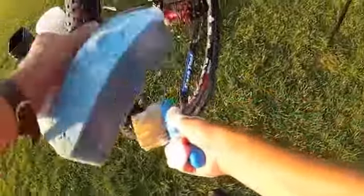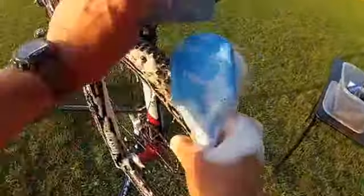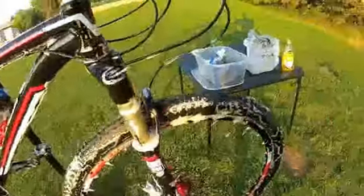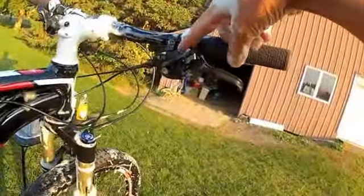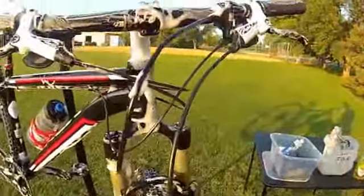Some good notes. Let's get that front wheel. Where would you want some of the other brushes — those especially aggressive bristle brushes? We may want those on the tire. This tire does not need it as it's not so muddy, but if your tire is very caked up, this very stiff bristle brush is the one to use along the tire. On the front end, I don't want to be scrubbing inside the shift levers — we try to avoid that. We may just wipe them off with a rag. Handlebars, stem, and even the grips — if we've fallen in the mud, we've got to clean the grips off. Brake levers are not a problem, but shift levers are what we're trying to avoid.